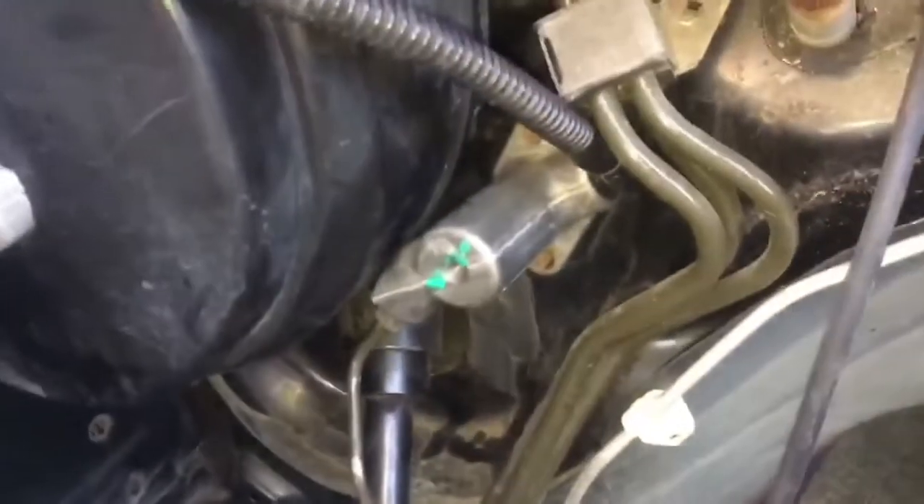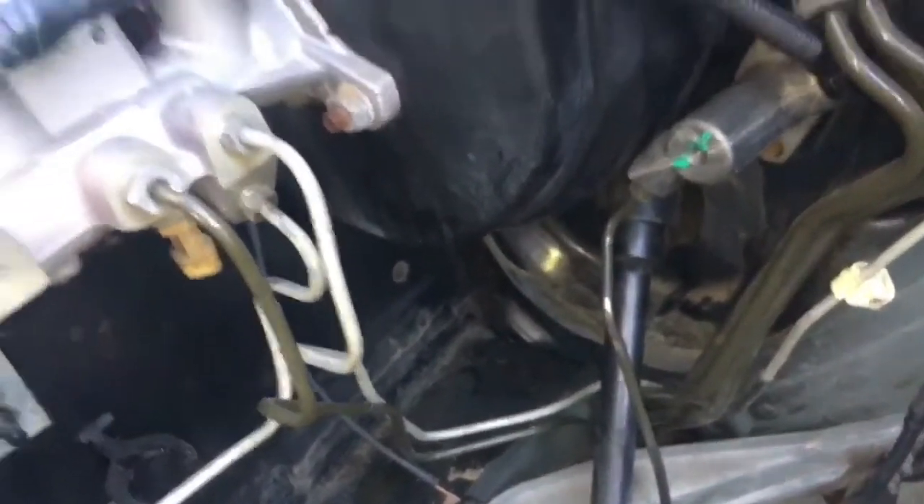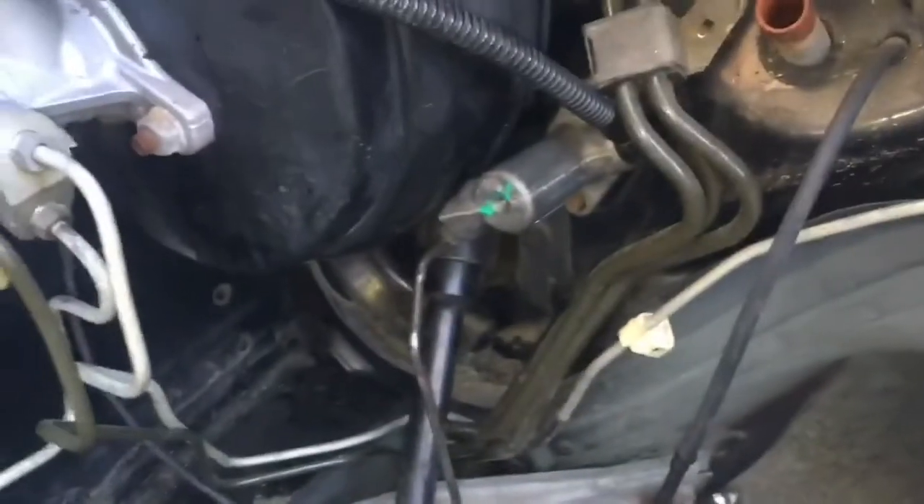Button up these few bolts up here, then put the shaft on underneath on the pedal. All the bolts underneath the dash for the pedals are all 13mm. If I can give you one tip - deep sockets. All the threads seem to hang out a lot further than they need to, so a normal socket won't go over it. Long sockets will always help.